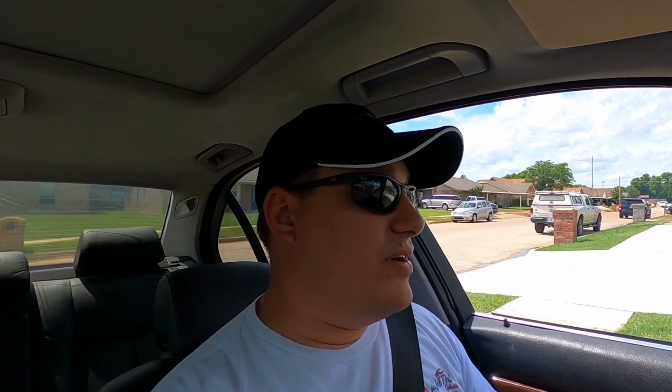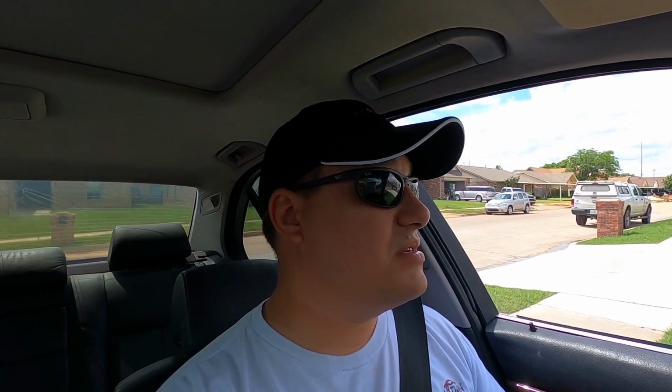Well, guys, I think we got it good and pissed off right now, because it is actually smoking quite a bit. I'm going to see if I can take you guys back there, and maybe we can take a look at that smoke and get a better idea of it. I don't know. It could be fried rings. It could be a head gasket. Normally, you can tell by the color of the smoke, and normally you can tell by the smell. You can smell when oil's burning. Honestly, guys, I don't know what this smell is. It smells like something's burnt, but I can't tell what.